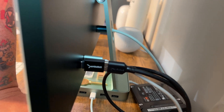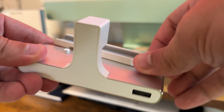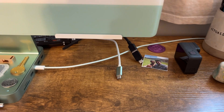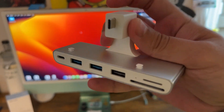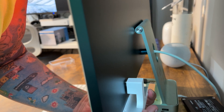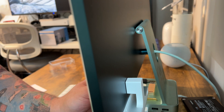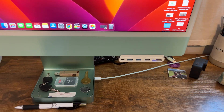You can see there's only two USB ports back here. I'm going to unplug this cable, and with everything unplugged, we're going to slide this piece off. This little piece slides off and is able to fit onto the bottom of your iMac like so. Then you're able to take this piece, plug in your USB-C port, and slide these little plastic pieces into place so that it's all mounted. See how the plastic pieces are lined up — now the USB port goes right into place and you slide it to lock it. And there you go. Our little USB-C hub is installed. That was pretty easy.